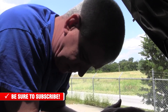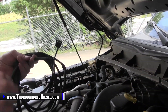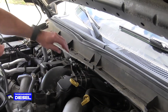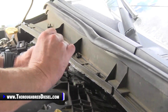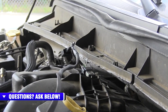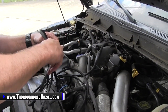We're going to start our installation. First thing — since you're fooling with sensors, go ahead and disconnect your batteries. You've got two connections on this unit: your first connection is at the MAP sensor, so you've got a pigtail for that. You're also going to have the main wiring harness going into the side of the transmission. First, disconnect the MAP sensor — it's male to male, female to female. Then run your wiring harness; the transmission harness is on the driver's side, so orient everything towards the driver's side.